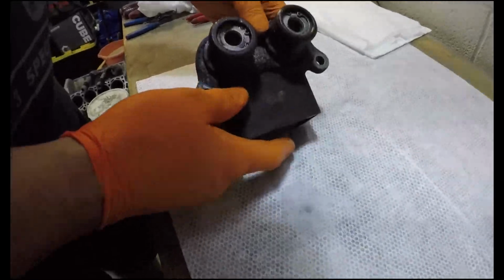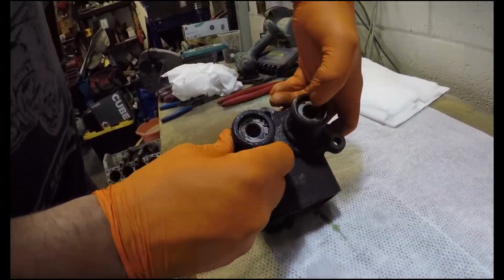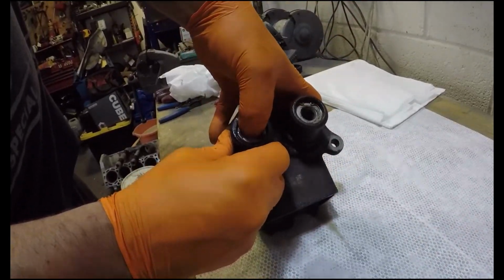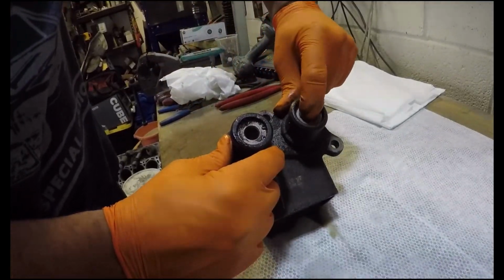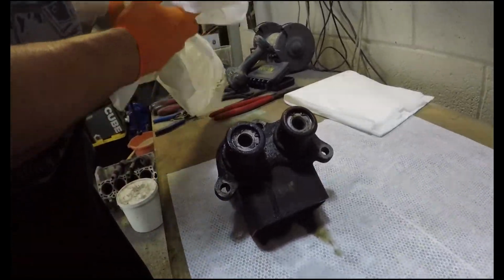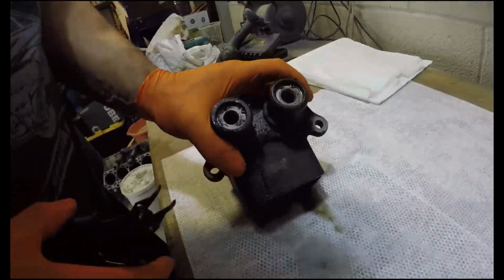So basically you've got one side for the brakes and the other side for the clutch. That one's very free. This one very, very stiff, and it has a lot of resistance coming back up as opposed to that one, which would be really the clutch side. Yeah, that's it. So probably got an internal seal point to take them out.